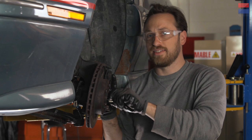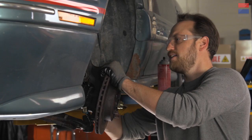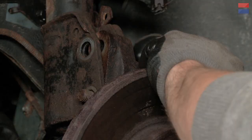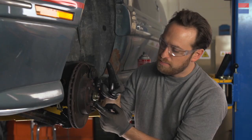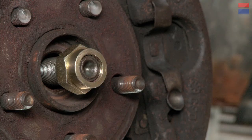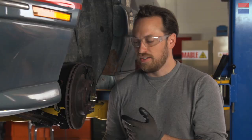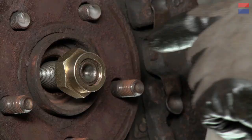So we can actually spin this down and start putting the whole suspension back together. Now I'm going to take one of these bolts and put it into the strut just to make this a little bit easier to put it all back together. Now because this outer flange is actually crushed a little bit, that provides an interference fit for the bolt. The idea is when you put this on, you don't want it to come off, so that interference fit holds the nut in place. Cars have different varieties of this though — some have a shaft or a hole with a cotter pin, others have a slot in the axle nut that you pound a version of this flange into.